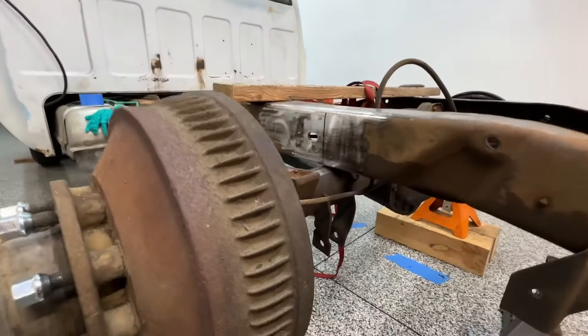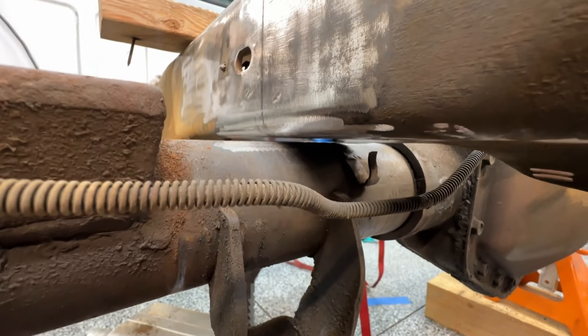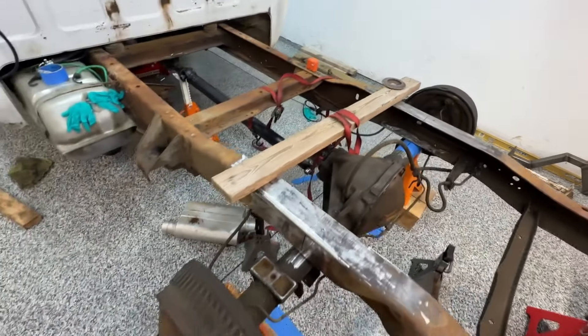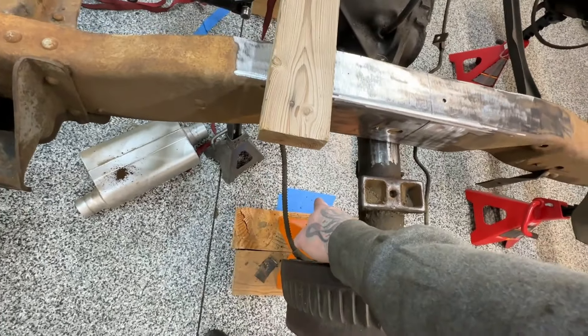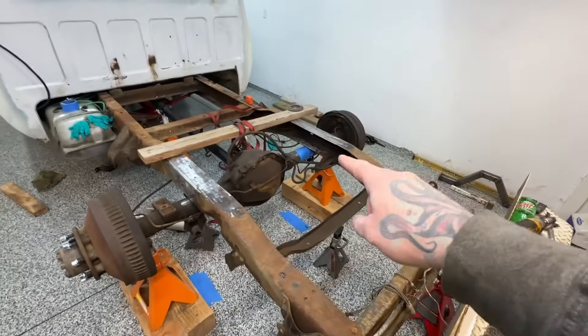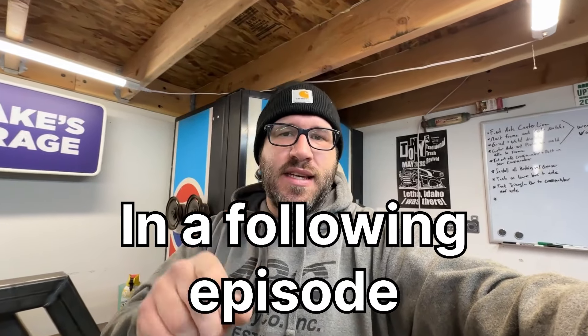It's the next day. Let me show you where we left off because I got a little bit done off camera — nothing that really had to be recorded the whole time. What we did was we got the axle sucked up to the frame, and it actually rests just about on that. It is super, super close. We're going to make sure that this thing is centered — remember we plumb bobbed it before? We're going to do it again, make sure we're on our marks on the driver's side and passenger's side. Then, once we know those are 100% true, we're going to hold it in place with these U-bolts. My truck is sitting at half travel.